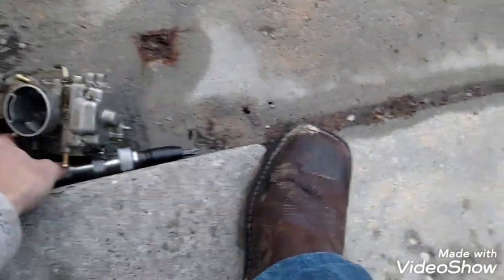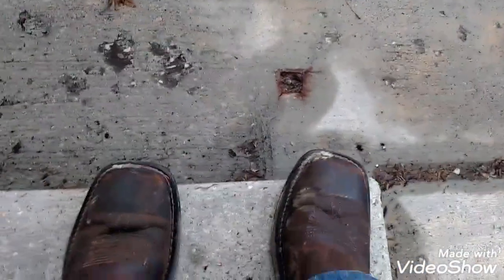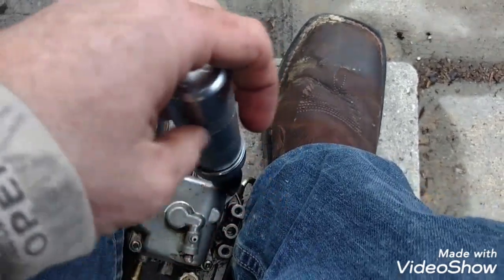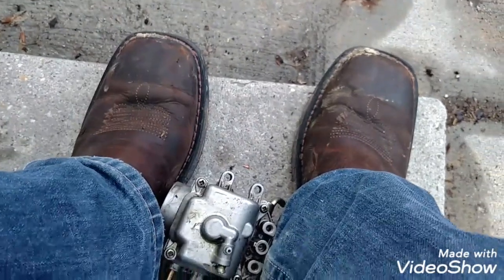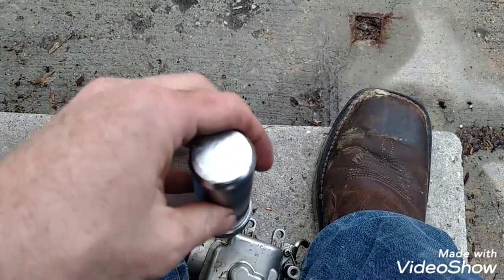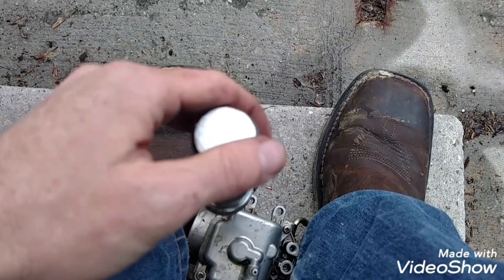So you stick it down in the screw, hold it with my foot, stick it down just like that, right on top of the screw. And then all you do is take a hammer and smack this, and it slowly spins its way, and it makes it so that those become loose. I tried with some pliers too, and I was kind of stripping them. So if they're in there too tight, you just smack it with the hammer, and it loosens them right up.